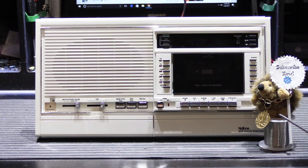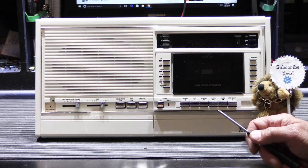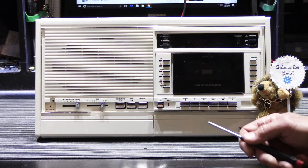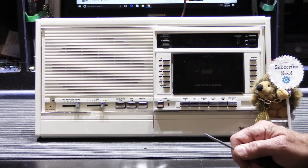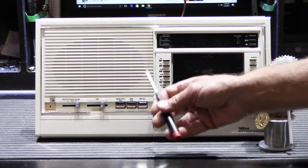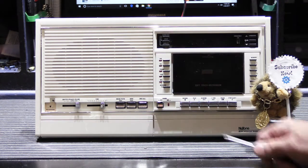Sometimes on sets like these when the primary power supply fails, it will send out incorrect voltages to each individual board, or sometimes some of the individual boards, and that will put an extra load or demand on the local power supplies on those boards and that becomes a problem also. So this is entirely what I call an age-related problem. After 27 years there are components in here that have simply run their lifespan and have failed to the point where you get this massive buzzing noise.